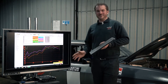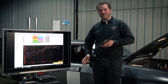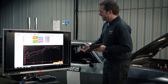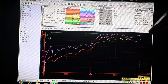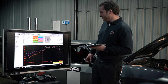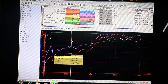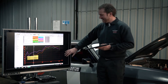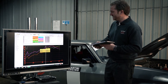We've just completed a series of power runs and done a whole load of tuning on the car on the rolling road. I'm going to go through each power run I've done, what corrections and changes I made to the carburettors. First test: I shoved the carburettor straight on with 220 main fuel jets and 200 air jets. That gave us a pretty rough result - it's maxed out lean, the machine can't read any leaner. This line is our fuel mixture, the orange one is horsepower, and the other is torque - it's a horrible curve because it's running dreadfully lean. Right, scrap that test, put some richer jets in.